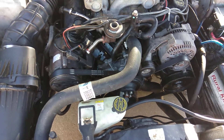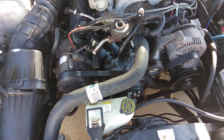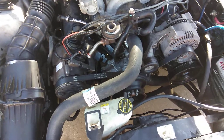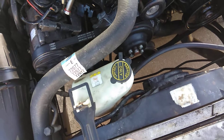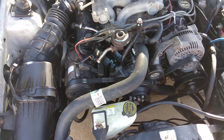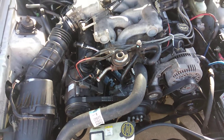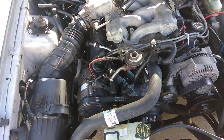You have to do this. The stuff doesn't cure to the motor — the coolant will not allow it to stick. You have to flush this motor and flush this radiator out until it's crystal clear water. I suggest you do it twice just to be sure, because you don't want to waste your $60 investment on that big bottle of Blue Devil you just bought.